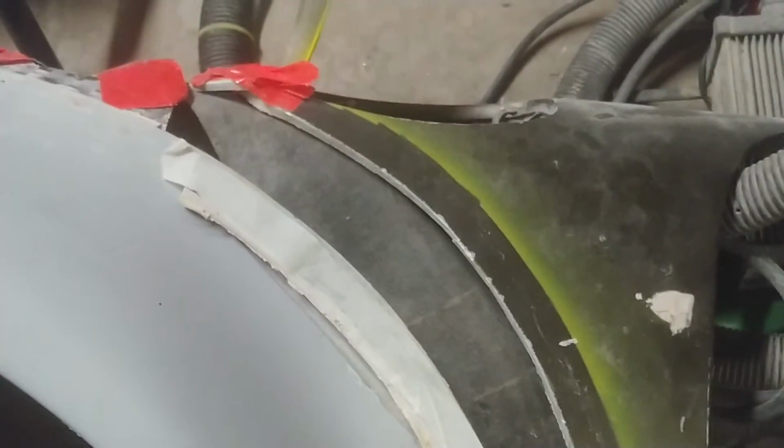And you can glass that in and make it one set. Actually, you can glass it in without even being in that particular spot. You can glass it in from the top right here, and then do your flange later on this side. Or you can come on the back side and glass the whole part in while it's still in place, so that way you know how it fits. Or you can take this out. I normally do it on the part, so that way my contour will stay the same, and I know it'll go back right. I don't have to worry about it flexing or anything like that. But you can do it on either side, but your mock-up is going to be there, and it's just that easy to make a part, to channel something or whatever, in 10 minutes.